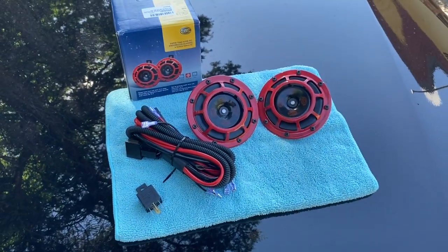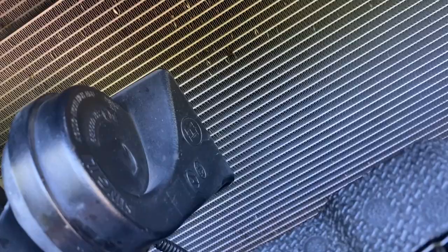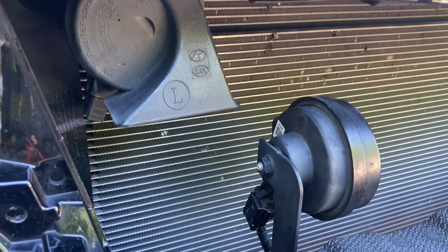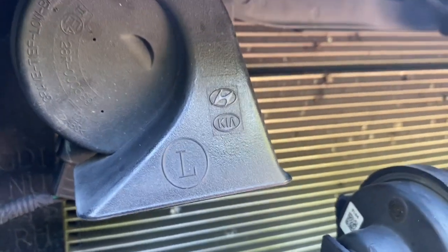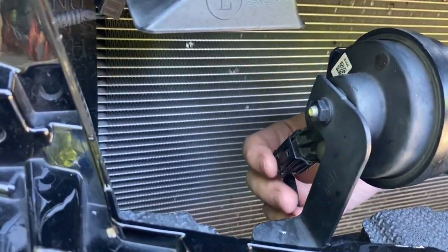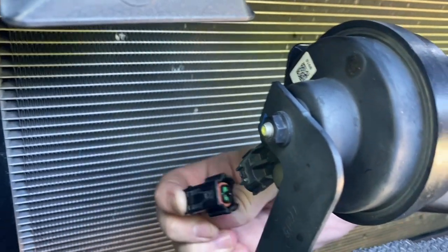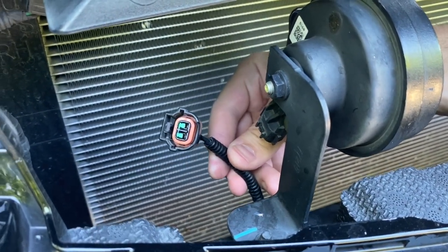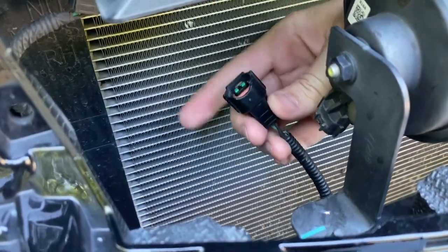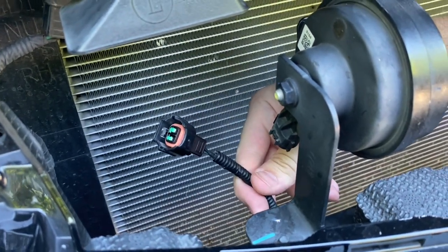If you look at the front of these horns you can actually see which one is the low tone and which one is the high tone — they have an H and an L on them. When we put these new horns in it's not going to matter where the high or the low is; you can change those willingly. And it's funny — you can see that these are compatible with Hyundai or Kia. We've first got to disengage the connectors. Stick your hand in here and pinch the clip until it pops up, then pull out the back. We have this type of connector and we're actually going to be cutting one of these off and using that wire later. Don't worry if you see this connector type — we'll talk about the blade prongs in just a minute.